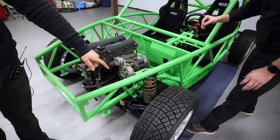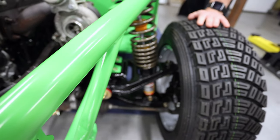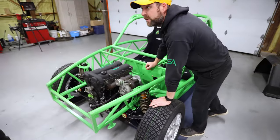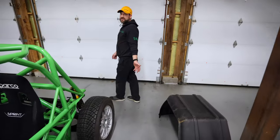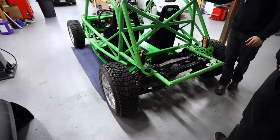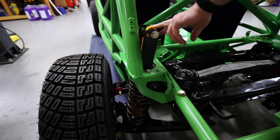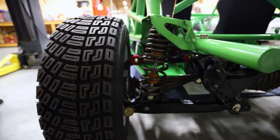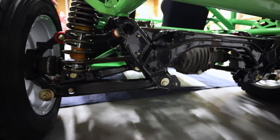Who makes the ball joints? The ball joints are made by Bauer - they're extended lower ball joints so you can get some more negative camber in the front. It just basically swings the knuckle out a little bit. So the biggest problem with the Miata is rear suspension travel. Look at how high that shock is up in there. Paco Motorsports has resolved this problem by basically inverting the shock, mounting it way up here - you get effectively a lot more suspension travel. That's clever how they added that adapter and flipped the shock upside down to do that.